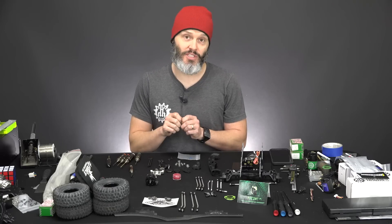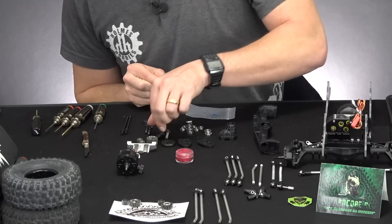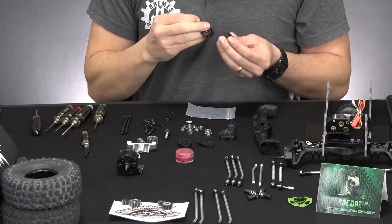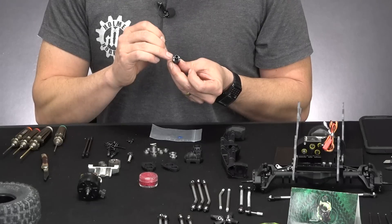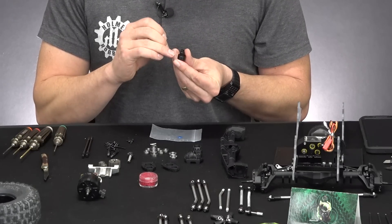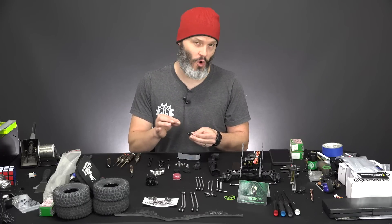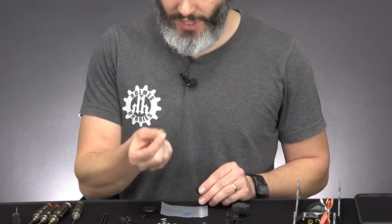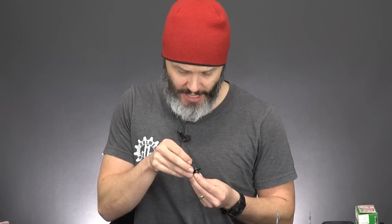I'm just going to make an assumption that these are grease-free enough. It'll be fine — it's a locker. What I do is just a little dab on the tip of the screw, and then we can shove it through our gear. If we look really carefully at the bolt holes on the locker, they are actually countersunk on one side but not countersunk on the other side. The countersunk direction is the one where the bolt or screw is normally going to come in through. So we take our screw, just dab it in a little bit of Loctite on the edge of the puddle, make sure it's on there — don't really need much. This is just to keep the screws from backing out over time. We slip our gear onto the locker, line up the holes and bolt it together.